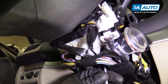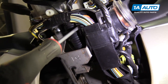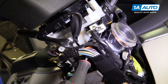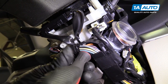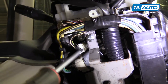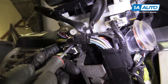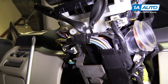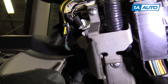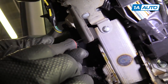Next, to pull the upper cover off, there are three Phillips head screws — they're hidden. You kind of have to go in between these wiring harnesses here and go up there. We'll take that first one out. There's another one right here in front of this white connector. Then for the last one, I'm going to pull the steering column outward and have it up with the adjuster down — that one is over on this side.